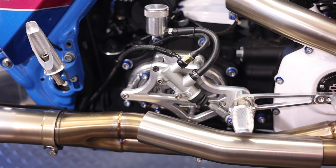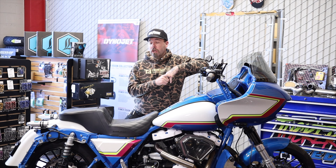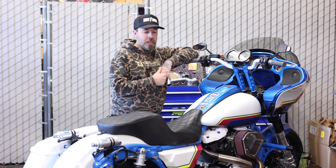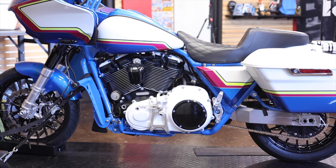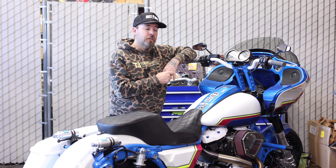On the primary side, I put in a Dark Horse Manowar compensator. In the clutch, I'm a huge fan of the Recluse stuff. I have the Recluse basket with their torque drive clutch plates and the Recluse slave cylinder to finish everything off on the hydraulic clutch. We also went chain drive on this setup — got a PBI front sprocket, chain drive, and then the AlloyArt rear sprocket with the cush drive.